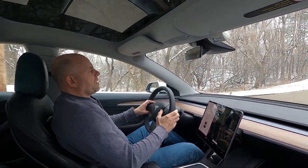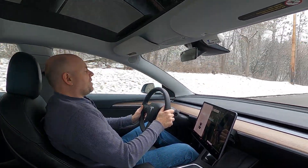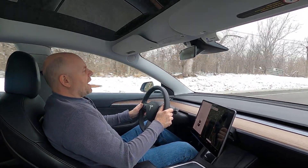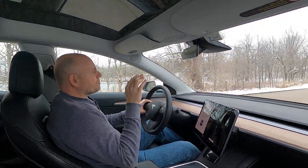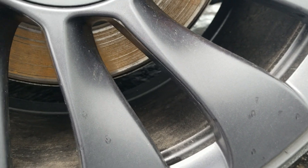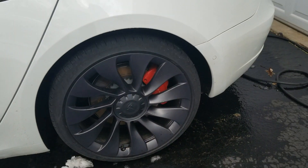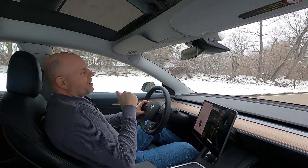For today's video I wanted to walk you through some ins and outs of brakes. This comes up mainly because recently we've had a lot of rain in our area. Any car parked out in the rain will get some rust on the brake rotors. All you have to do is hit the brakes and it blows the rust right off. However, the reason it differs with a Tesla — or actually any electric or hybrid vehicle — is because electric vehicles, as well as most hybrids, use regenerative braking.